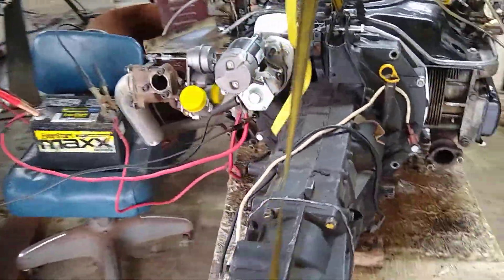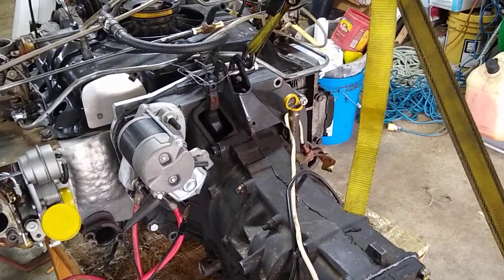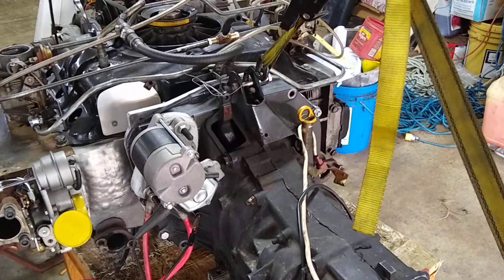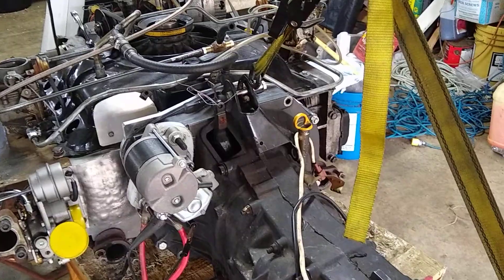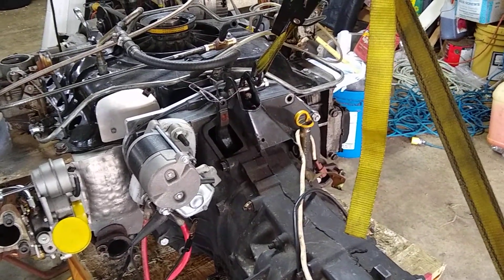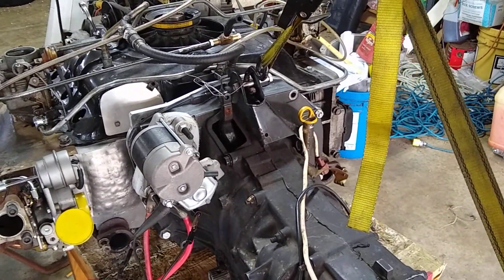On the business side, the Corvair engine is clockwise rotation versus counterclockwise. Subaru Gears has stated that the transmissions, when applied with 200 foot-pounds of torque or less, have no problem turning in either direction — no longevity problems or anything. Supposedly several, if not many, have been run this way.